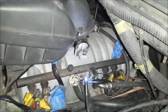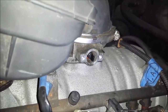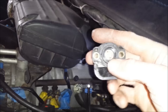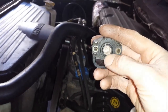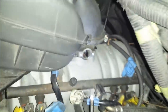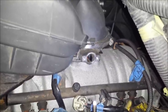I've got the two Torx screws removed. Now we're ready to pull the throttle position sensor out of the housing — we should be able to just pull it straight out. You can see how this works: there is a rectangular shaft coming out of the housing that's connected to the throttle plate. When the throttle plate is opened, this shaft turns, which rotates a collar inside. It's got two little tabs that the shaft pushes against. Basically this is like a potentiometer that sends a low voltage signal to the computer — each throttle position corresponds to a certain voltage, so the computer knows what the throttle is doing and can adjust the fuel trims accordingly.